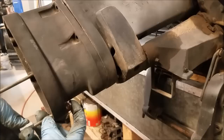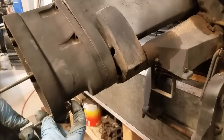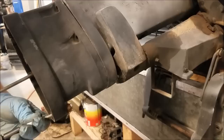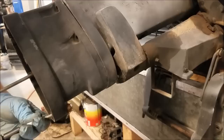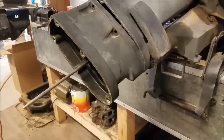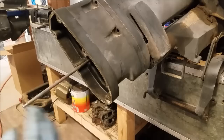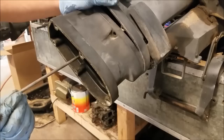Alright, I have a 1/4-20 screw followed by a little 1/4-20 adapter — let's go with that. Nope, it's not a 1/4-20. Alright, plan B. I removed the water tube adapter — the water tube just sits up in there, falls right out. I'm going to remove the power head so I can get the shift rod and the water tube out of there. Water tube's out. So I'm going to pull the power head off now so I can get the shift rod.